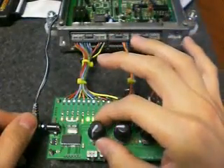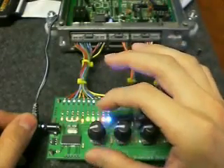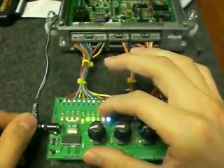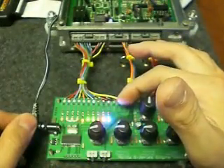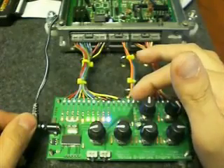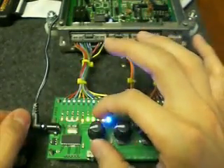The first thing we're going to do is turn the RPM up slightly. When we do this, we'll see all four injectors fire simultaneously. Then you can see — this is about the slowest you can get it — your coil light flashing, one for each injector fire, and then you can see the 1, 3, 4, 2 firing order happening on the injectors.